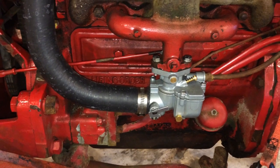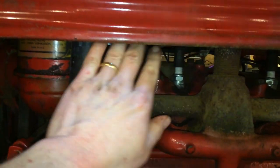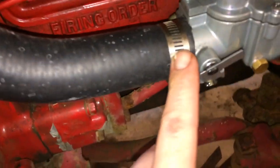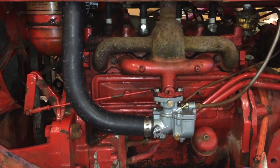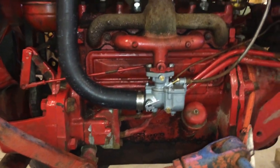Now the carburetor's done — I got the hose on there with clamps on both ends. You can't see the top clamp, but there's plenty of room to work with a nut driver or ratchet up in there. Before I tightened the top clamp, I noticed the hose was rubbing on the throttle linkage. To remedy that, just twist the hose a little bit before you tighten the clamp — it'll pull itself clear of the linkage. Make sure it's clear of the choke linkage as well. And to correct a misspeak from earlier — it's actually inch-and-a-quarter inside diameter. That's it for the carburetor. Post any questions in the comments below.